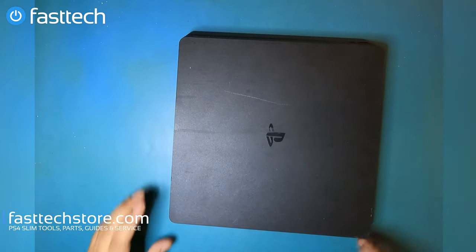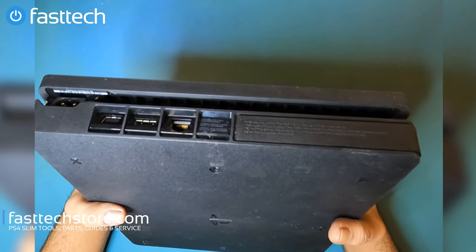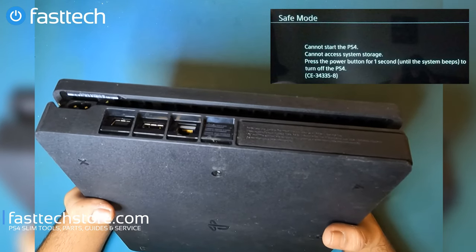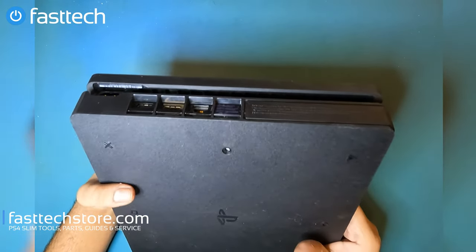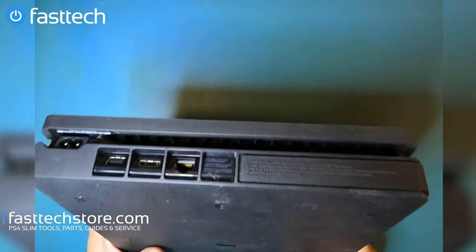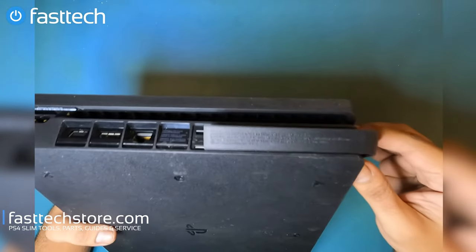First thing we're gonna do is remove the hard drive. I'll tell you why you might need to replace the hard drive. If you're getting the PS4 cannot start error message, which starts with a CE, you most likely need to replace the hard drive and reinstall the software. I did a detailed video on this, which is one of my most popular videos, and you can check that out on my channel. So to remove the hard drive, you've got to lift up this L-shaped piece like this.